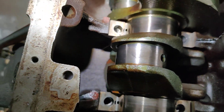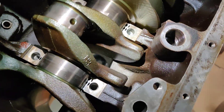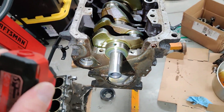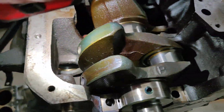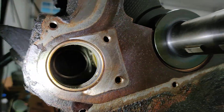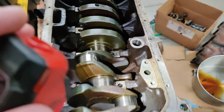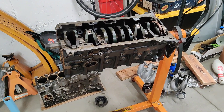If you're using stock M54 rods and you're just making an NA, non-turbo motor, you should be fine. I've put one in here before and spun it over and it looked like it was clearing just fine. It's just the E30 or B25 rods are very thick at the base and they can hit there. So it's really easy to make this work. Just remember: notch this out. Give yourself at least two millimeters — a millimeter at minimum — but just overdo it. Two, two and a half to three millimeters and you'll be fine. Then check the clearance against the bottom of the bore with your connecting rods. Just a quick little tip to help anyone else out in this endeavor of going 3-liter M20.